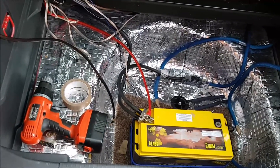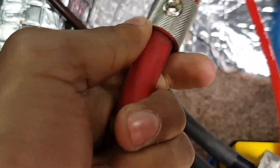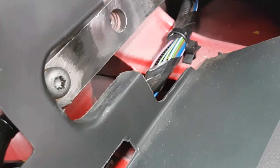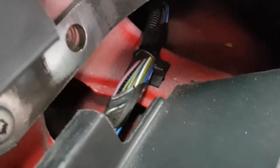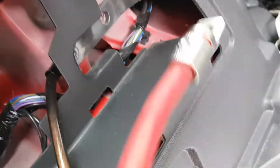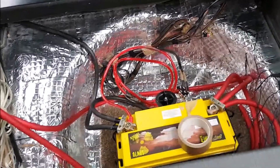I'll be using Rockford Fosgate ring terminals, zero gauge - fits in nice and snug. This will be for my grounds. I've already wire-wheeled the surface all nice. One is for speakers, one will be for my sub. Attached onto there and then straight to the battery.